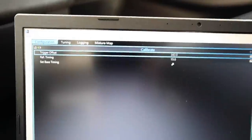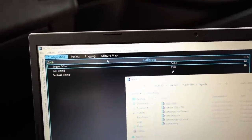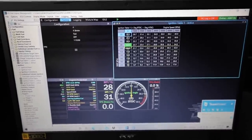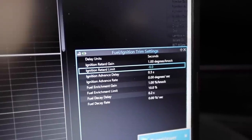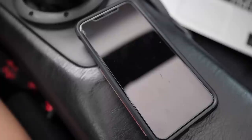There's a tuner. I don't know if I sent a layout file or not — I don't think so. You sent a base map. So let me get back to this. I may give it a little bit more here, but we'll see. I want to see how it responds first. I don't think we'll do anything with timing today other than just getting it to a safe level.